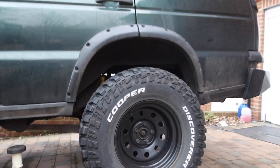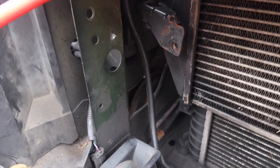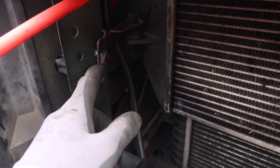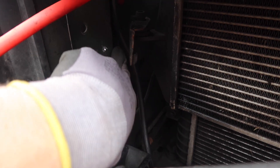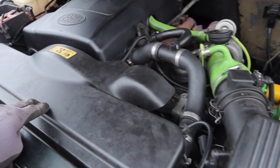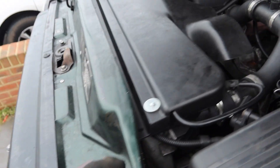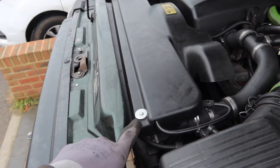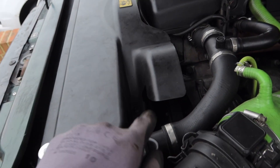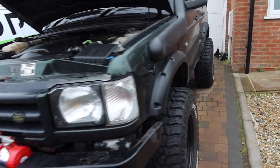Now I'm fitting the radiator mounts — I've kept the bottom ones completely stock and just flipped these over. These were upside down, so I've flipped them over and I'm going to bolt it right to the side there with the bolt coming through the back — nice and easy. This one mounts the same; you just need to drill the hole a little bit lower. I also modified this cowling — I literally cut this little corner off right in here so it clears and fits back on perfectly. Ignore the shiny new screws; the little captive brackets are broken but there are still two holding it on.